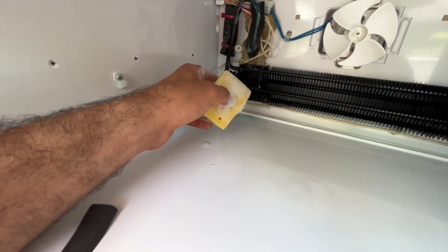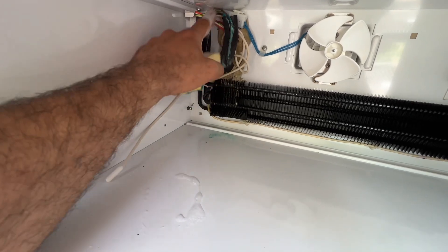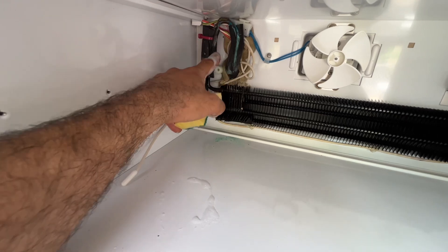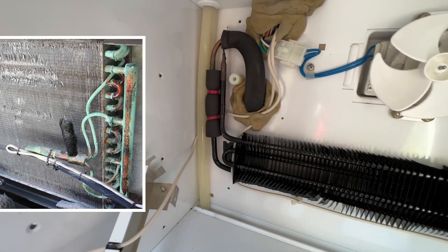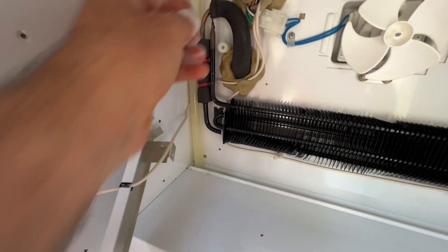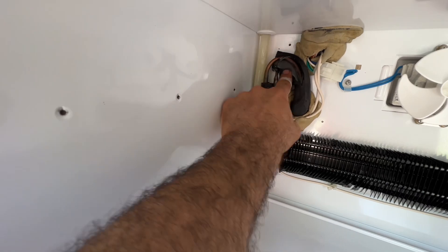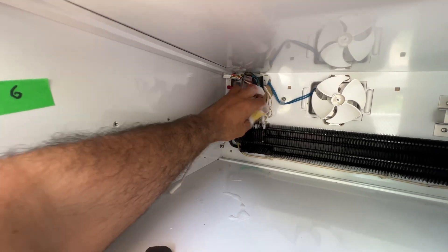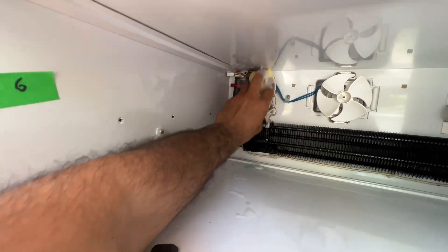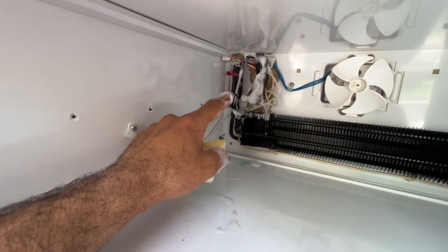Try your best to find a place that has more corrosion built up. Look at the evaporator on this one with its connections, the capillary tube on the heat exchanger, the way it goes to the evaporator — we've got lots of corrosion built up here. The bottom one looks very clean; it's not that bad compared to the top one. You can use your soap and even get a spray bottle to keep spraying it all over the places. While your fridge is running, keep an eye on it and you will see bubbles that will confirm if you have a leak or not.